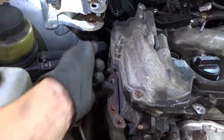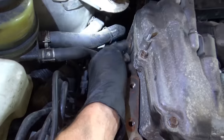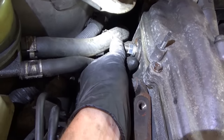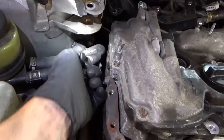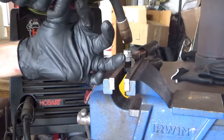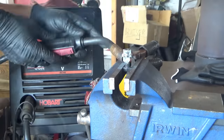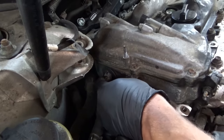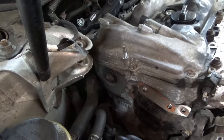We have to remove this bolt to get the phaser out, and then the cam chain will be loose, and we'll remove the exhaust camshaft. I don't have a 14mm hex socket — I have up to 12mm and a 17mm — so I found a nut that's 14mm that'll fit right in here. I want to weld these nuts to this bolt so I can grab onto it and get that cap out. Let's weld this thing up. Got the special tool installed — sides of 17. Works like a charm. I'll keep this one in the toolbox.